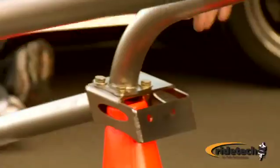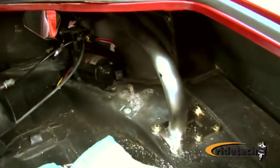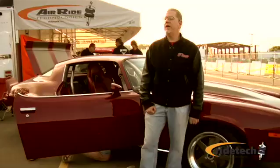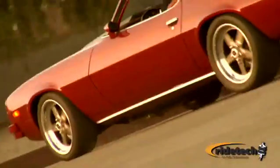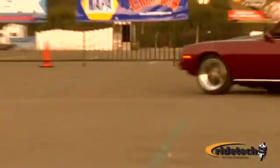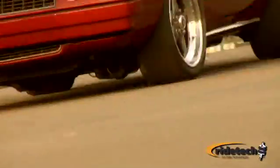Back here we pick up the package tray in both planes — both the horizontal and the vertical plane. The trunk bars, which fasten from underneath, marry that to the rear frame rails of the car. This makes the car really rigid and more predictable to drive. Normally the flexing of a car will cause handling to go away and the car will not act in a linear fashion as the body twists. With the tiger cage, you're essentially making it a solid box from front to back — that's the advantage of the tiger cage.